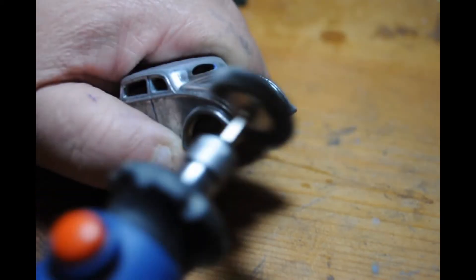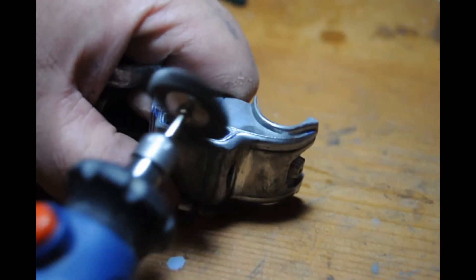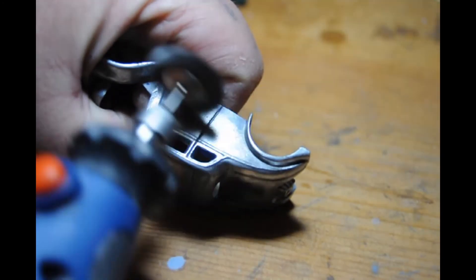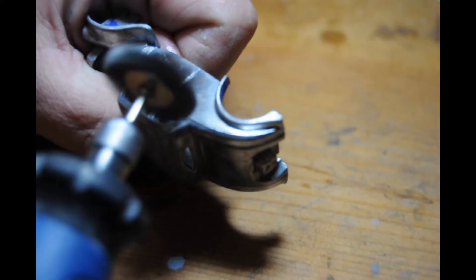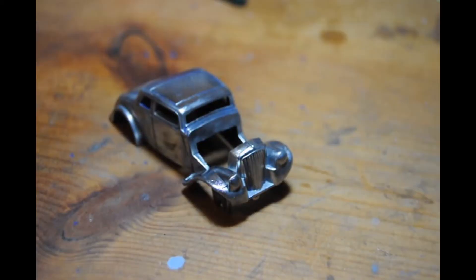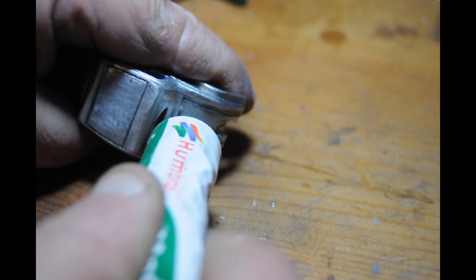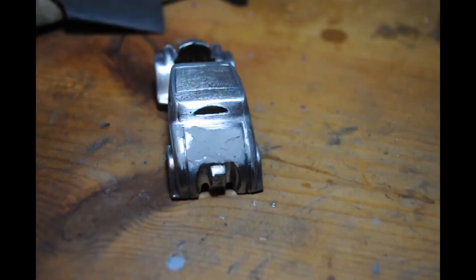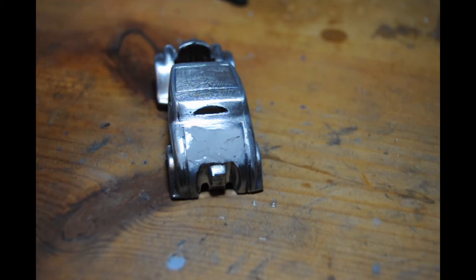I didn't realise it when I did it with the caustic, but it was actually dented on the boot lid as you'll see - you can probably see it there. Here I'm just cleaning round and getting all the loose paint off. Here I'm putting some filler in the dents in the boot. Once dry, use sandpaper on it and sand it down.